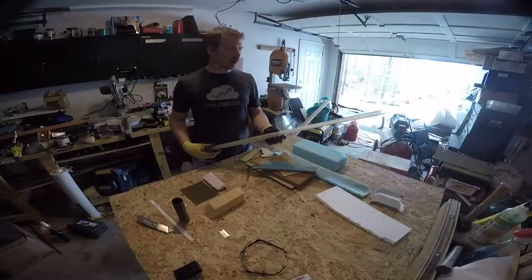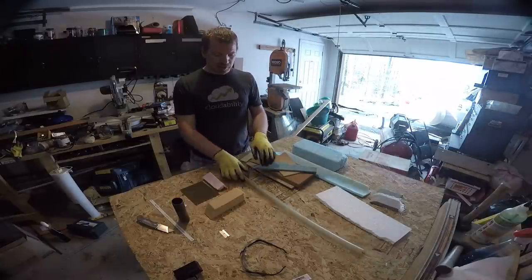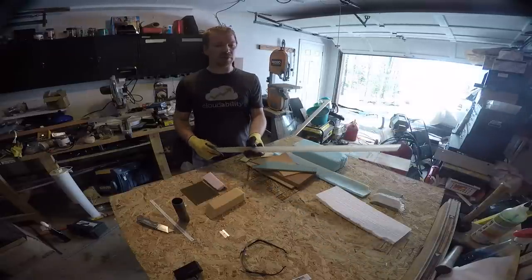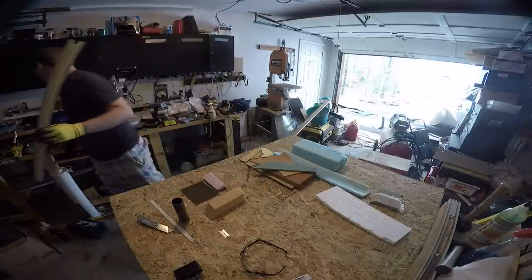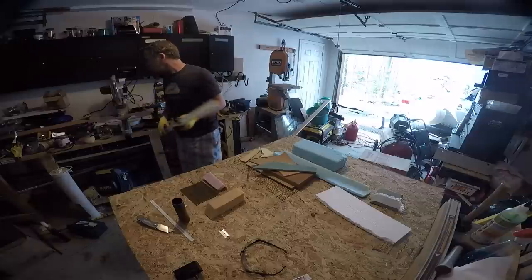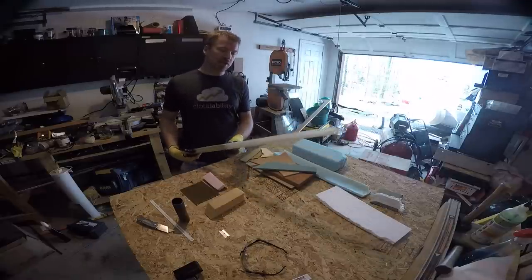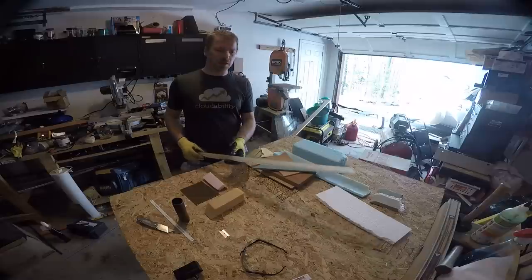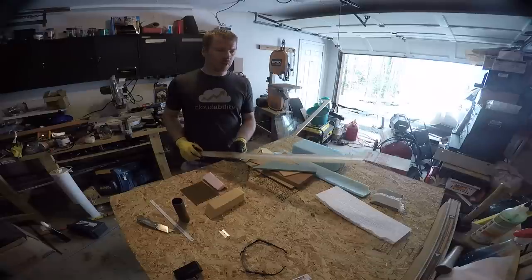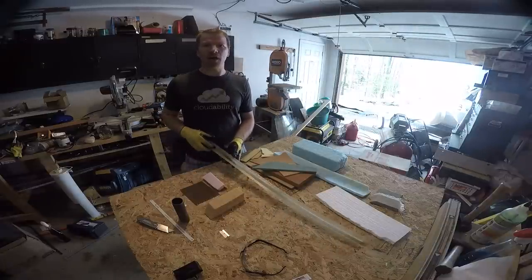This kind of thing makes great electrical channels and wiring runs. It is waterproof, especially if you seal it. You can attach it with more fiberglass by overlapping the edges, or you can use something like RTV to attach it down — silicone caulk or any exterior sealant will seal it up pretty nicely. The advantage of using RTV — RTV red is pretty popular — is that it's adhesive, it'll stick, it'll stay waterproof, but when you want to peel it you can slide a knife edge under it and get at whatever's behind it.